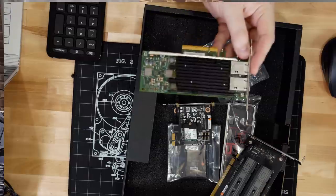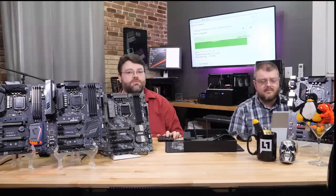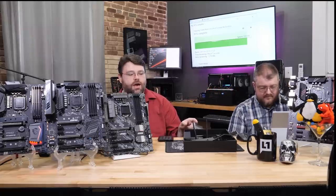Now, when running this peripheral, I will probably have to give up some of the CPU connectivity. Probably throttle my GPU to x8, because I don't know, it might work okay through the chipset lanes. I don't know. It'd be worth a try, because a 10 gig is a gigabyte per second. So it's only 1/4 of my DMI bandwidth. That might not be terrible.